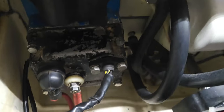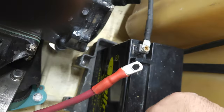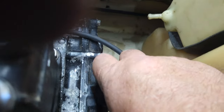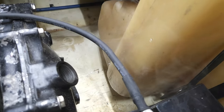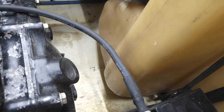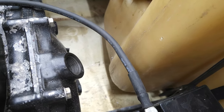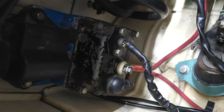I have our wiring all installed and buttoned up. I hooked up the battery, then unhooked it — because I smelled something and saw smoke coming out. I smell electrical burning. Evidently our rectifier was bad, and it was sending voltage back in through the ground side on the stator. I don't know if it cooked it or not. We're going to have to pull this back apart and disconnect our rectifier and figure it out.